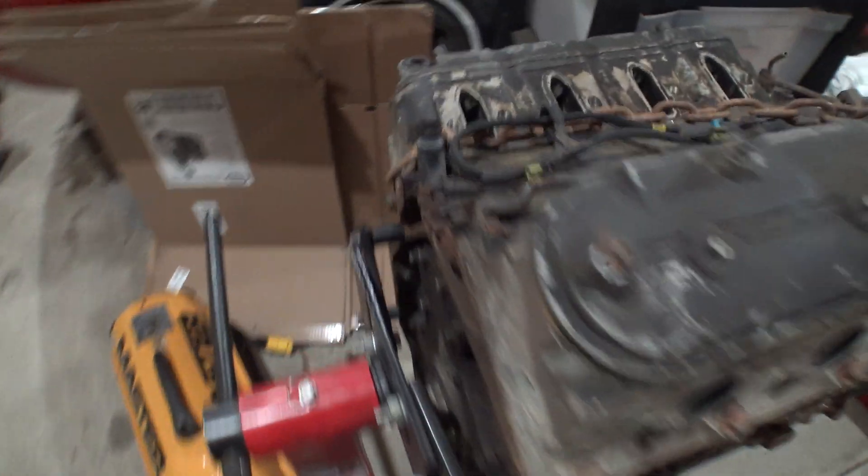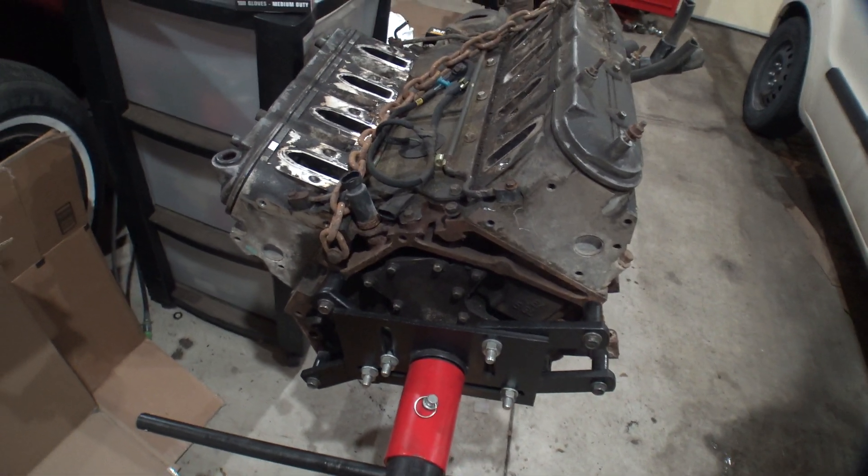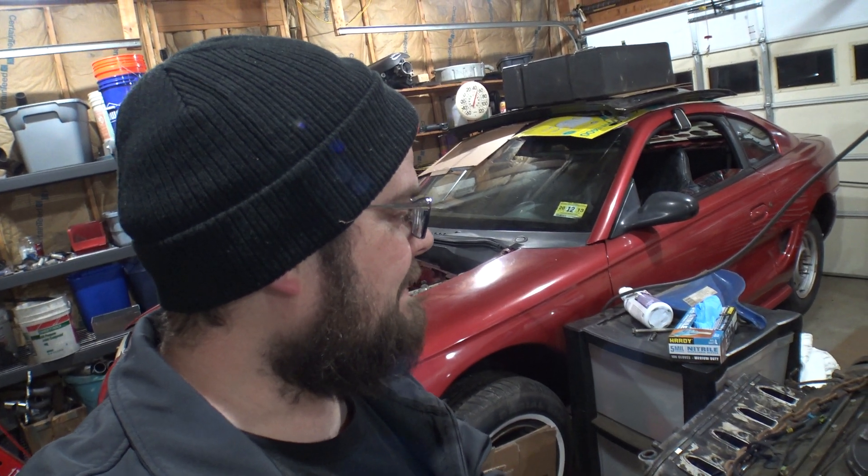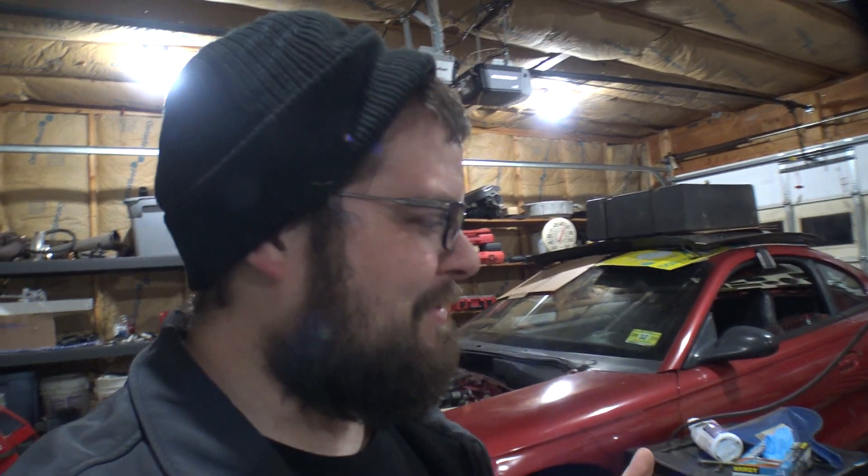Great 6.2 heads, all that great stuff. We'll dig into this on video again and see if we find any surprises. I genuinely hope we don't find surprises. What I like is a completely boring stock engine — I like it to just be junk and used, because those are the most reliable. If this thing ran for 300,000 miles, what are you going to do in there to make it run better? I like what Jay from Real Street Performance says: 'New means never ever worked.' If the engine was already running and you did bearings, cam bearings, oil pump, you're leaving yourself open to possibilities of bad brand-new parts that don't have a clear working history. It's like having employees without a background check.